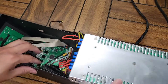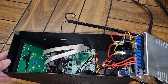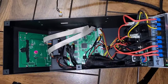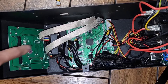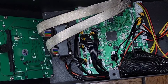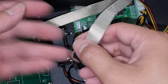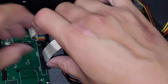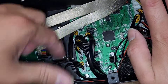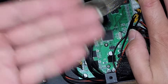We were just going to talk about the screen. So here you have the screen, and the reason why the knob isn't working — if you look here, you can see that cable is moving and has come completely loose and unplugged on its own. So make sure to push in all these cables, line this up right, and then just push it back in. Make sure it stays in place — it shouldn't just come out on its own. Maybe from gravity, or possibly from shipping vibration or the fan vibrating.